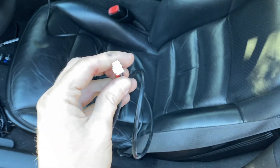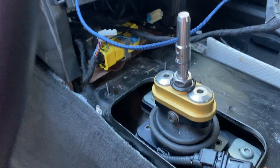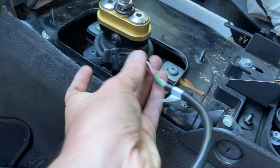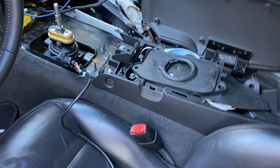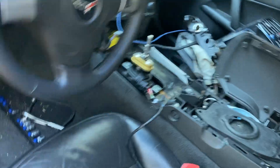All you're going to do now is connect the two ends, pull it back through, and secure the wire away from the exhaust. On the inside, you can see the wire coming through the tunnel torque tube area. This other end runs to wherever you decide to mount your gauge. One end goes to the O2 sensor, the other end is for the wideband — so if you ever need to replace the sensor, you can disconnect and pull it right through with no problem.